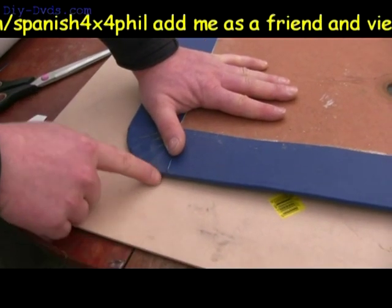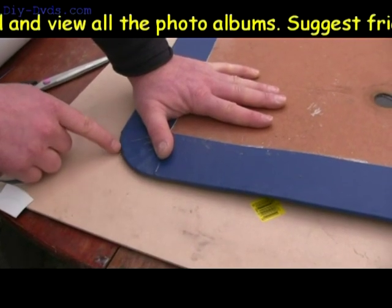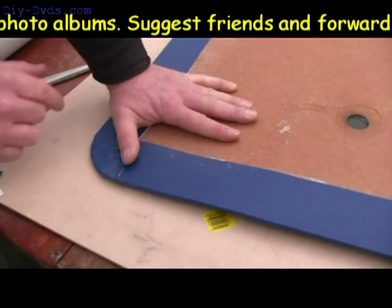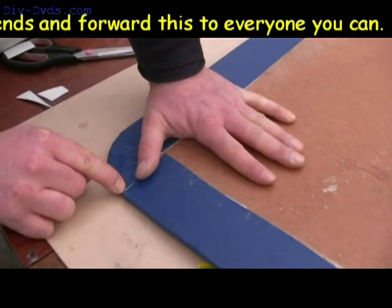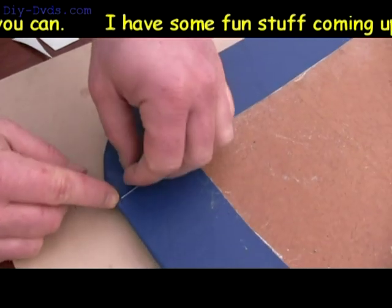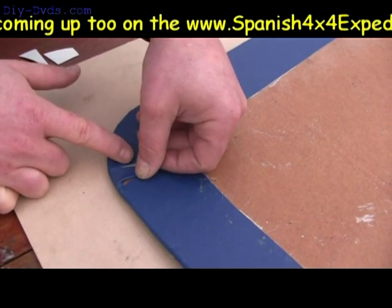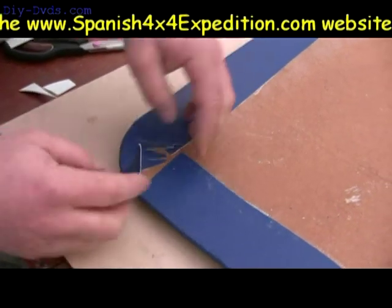So now we're going to hit that with some spray glue, and all the cuts are just this side of the backing board — and you can see the little creases you get there. So you need to get your cut right close to the edge, otherwise that will end up being a fold like that, and it will just keep your door panel off your door, which is not what we want.